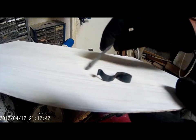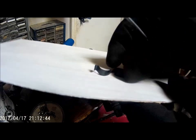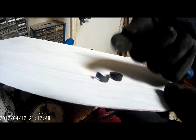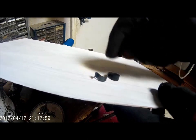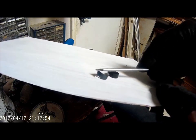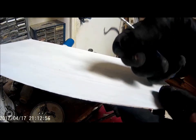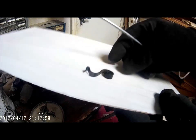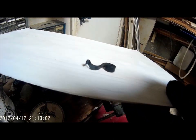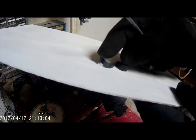Taking a closer look at this spring — see how it's kind of coming up here. Instead of being flat on the paper, it kind of flares up. So I'm going to heat this up and adjust it, because within that holder it hits the top. I want to make sure this is as close to OEM shape as possible. Let's heat it up and push this down.